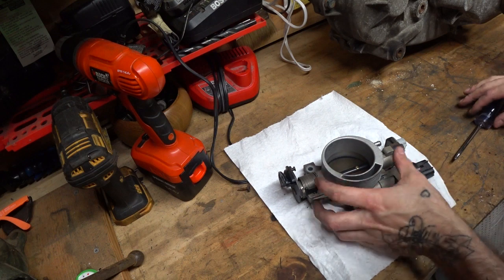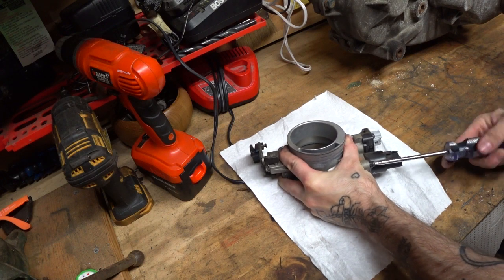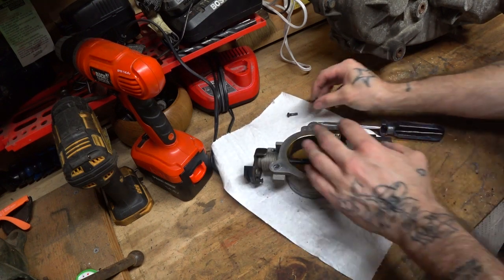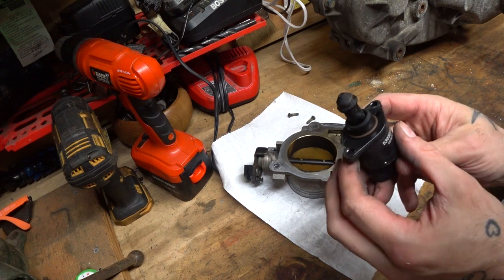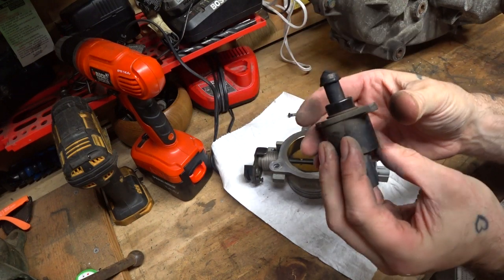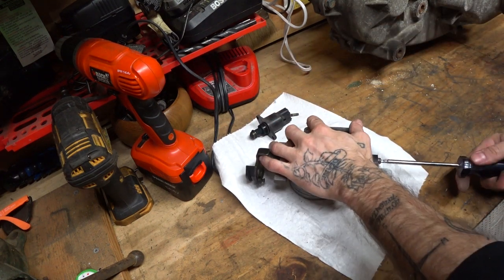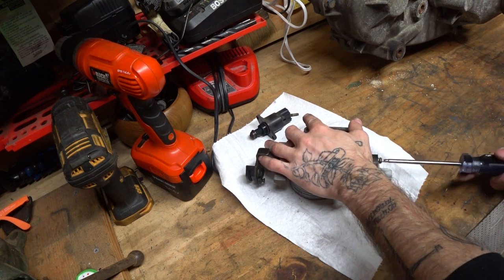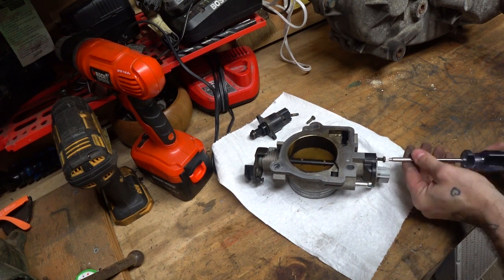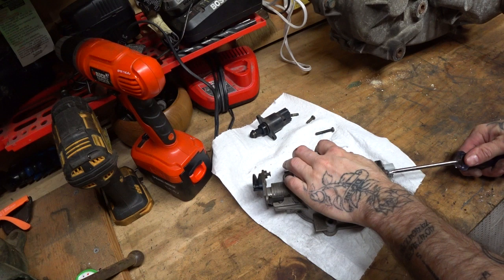Let's take this throttle body over to the bench and take a look at her. First, we'll remove the idle air controller. We can examine it — and this thing looks awful. I've definitely been running a little rough and my idle's been bouncing around; this would absolutely have something to do with it. Look at all that carbon. We're gonna put this aside and clean it up too. Now let's remove the TPS sensor. If you've ever messed with Jeeps, you know the TPS is often something that haunts us — go through a puddle, get water on your TPS, and all of a sudden your transmission's shifting funny. It's a huge problem on the 4.0; not as big a problem on the 4.7, but oh boy.